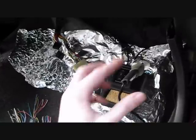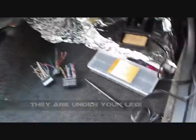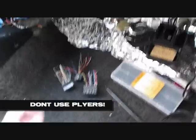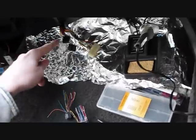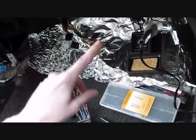So what you're going to need is a soldering iron, heat shrink, a pair of strippers, some pliers. You're going to need to strip all the ends and then cut and solder one at a time, checking your work so you don't mess it up. I've got a bunch of diagrams — like two or three of them — printed out showing all the different pin locations and all that, so I made sure those are all correct.